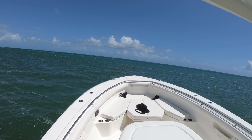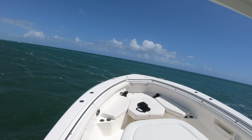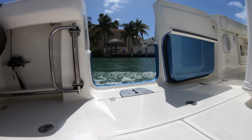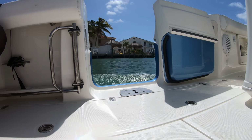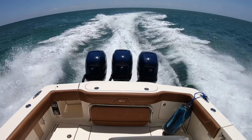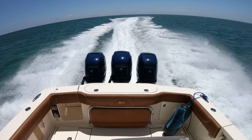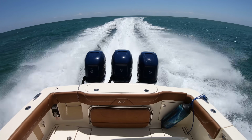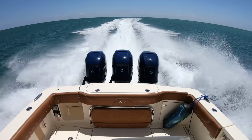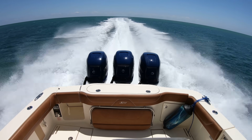It's also important to do the sea trial just because you want to make sure that you like the way that the boat handles and that you like the ride. Some boats can track hard to one side, list, ride bow down plowing through the water, be underpowered from the engine, splash a lot of water into the boat, or just porpoise really hard. If you aren't familiar with the ride of that style and brand of boat, it's usually a good idea to make sure it rides the way you want it to before forking out the cash and buying something you don't like.